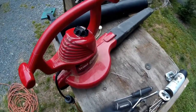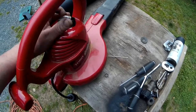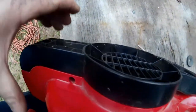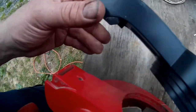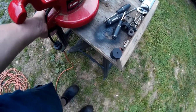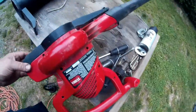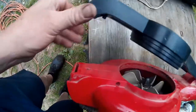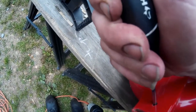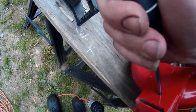I've been futzing with it, had it on its side. I think the problem is there is a safety switch right here to make sure that this is plugged in. I think the safety switch is going bad — that's what I was wiggling around with. Let's take this back off; we'll be very careful. I thought it was the safety switch.